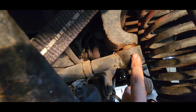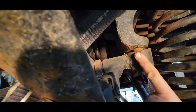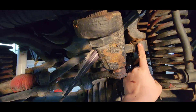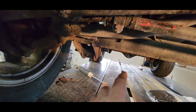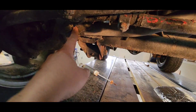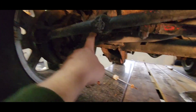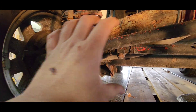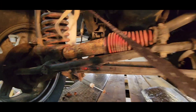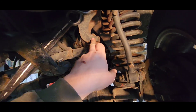This is our track bar - it keeps the front axle in place. That bolt can go left and right, and it comes down here and hooks into there. This end is good, nothing's moving around. But with that other end moving around, that's the only thing keeping this whole axle from shifting. So yeah, that's on the list of things to get addressed right now.